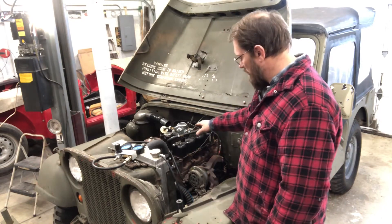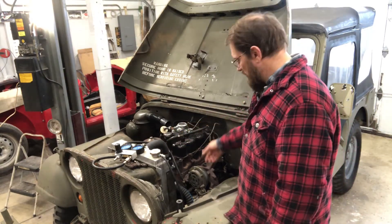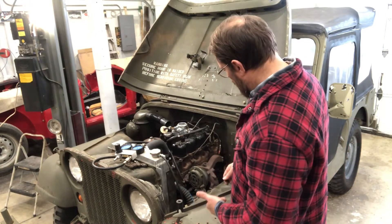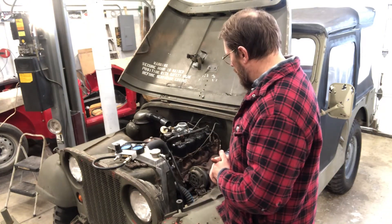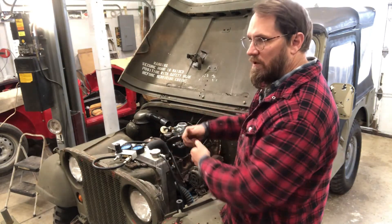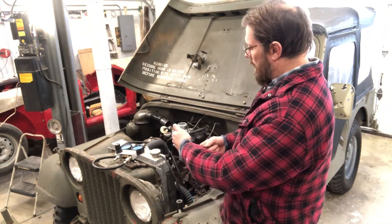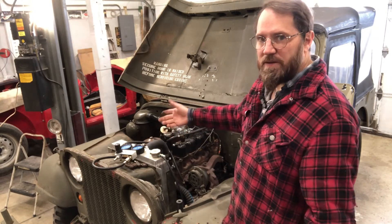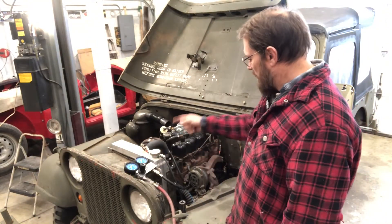With this one we can't really do that so easily because you can't see the exhaust valve as well. I can see the intake valve so I could do it that way, but I may just try to turn it until I can feel pressure coming out and then find top dead center that way. I brought it up to top dead center, put it in gear, and locked the brake on.